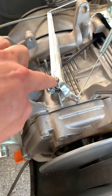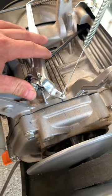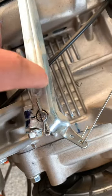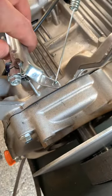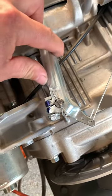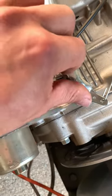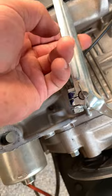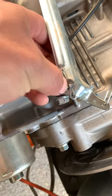What I did is — this is a little shaft that goes down into the governor and this is what turns and controls your idle. I took this arm out, used a drill and opened up the size of the hole for this arm, then drilled a little hole through there so I could put a pin so that this arm wouldn't lift off. So now it just works as a swivel. There's no control from the governor, so even if this shaft turns, it does nothing to the actual throttle body because the shaft no longer has traction or grips onto the arm.